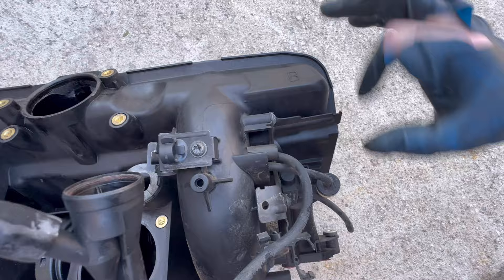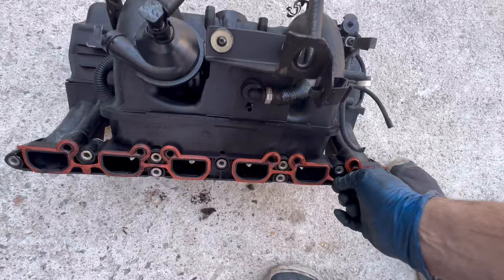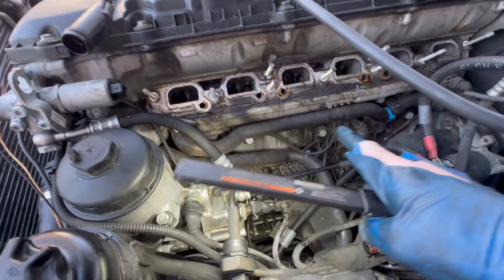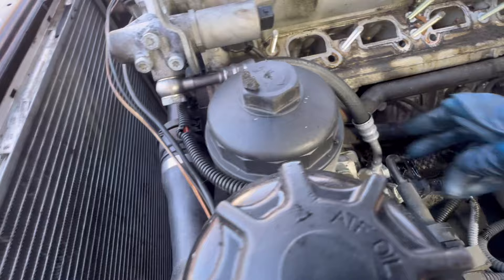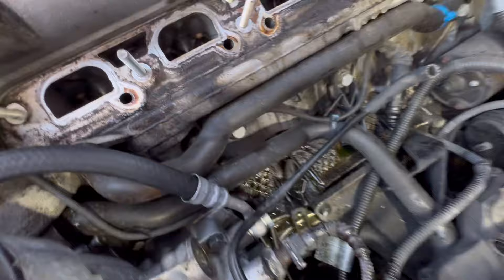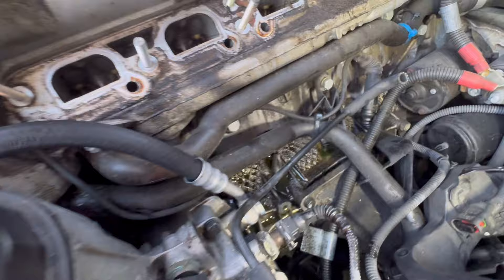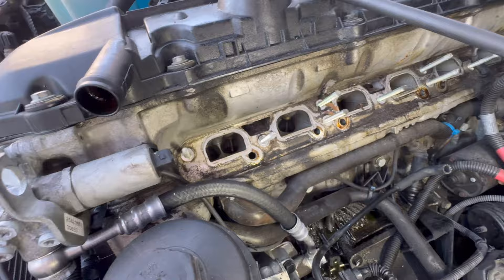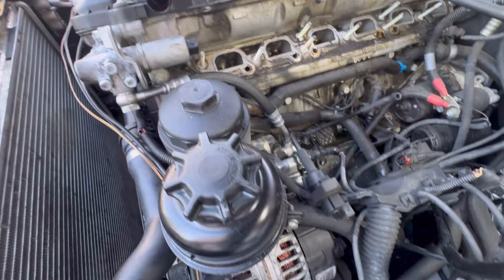That disconnected line — we'll replace all that. This cap sometimes can rot and deteriorate; this one is actually splitting, so we'll order that too. Intake gaskets are pretty hard and dry, so I did order those. Here you can see the water lines we need to replace — these two black lines. You can see how this is brown, meaning the plastic is all aged out and needs replacement. I thought this was wet oil but it's actually just coolant leaking down from there, resaturating the old oil leak. The oil filter housing gasket itself looks okay, so we won't mess with it. This CCV drain is all gummy — it's garbage.